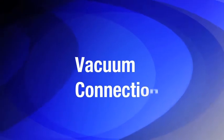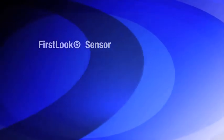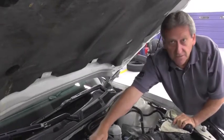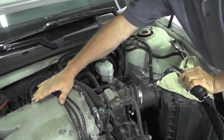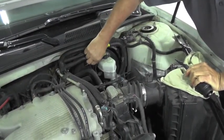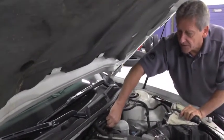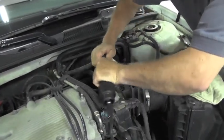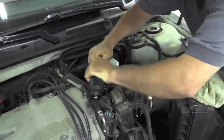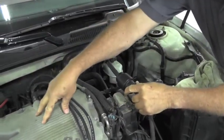In this next demonstration, Louie will show you how to make a vacuum connection as well as an exhaust connection with the First Look Sensor. We must first find a centrally located vacuum source that covers the whole induction system. On this 2008 Chevrolet Impala with a 3500 engine, we're going to the brake booster, pulling it off the brake booster, and taking our adapter, making sure we have a nice snug fit. This couples it so that our sensor samples the vacuum within this induction system.